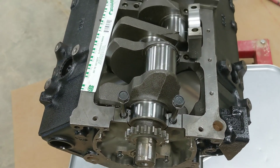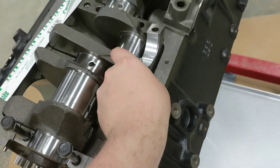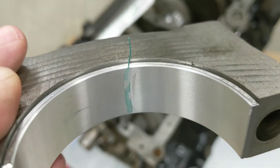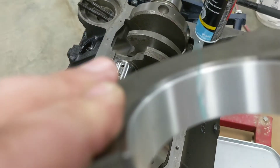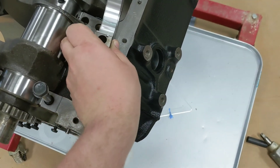This was recently all machined — they did a great job — and I'm just doing this as a double check to make sure everything is right. Then you go and clean the PlastiGauge out of the bearings. You can use some brake clean and it just kind of melts it right out of there, getting it all clean and ready for finish install.